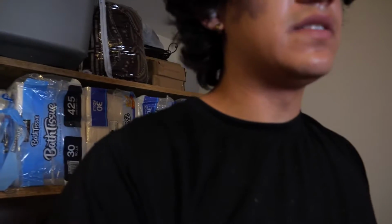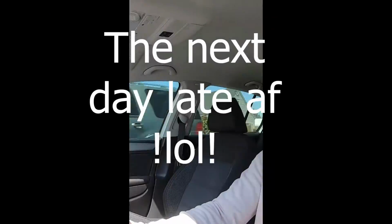Since I'm 2/3 of the way done compounding, I'll let you know what I think about the Meguiar's 105. It works good. The results at the end are really good. The only thing is it's super dusty. I don't know if I'm using too much product, because I've already tried using slightly less, and then more, and then less. It just gets super dusty. There's not anything you can really do. Just know that it's gonna get dusty, and have a rag and some detailer spray ready to spray off the next panel you're gonna work on, because everything except the panel that you're working on is gonna get super dusty.